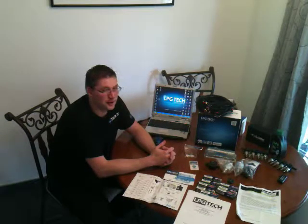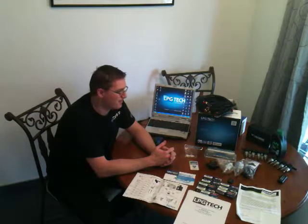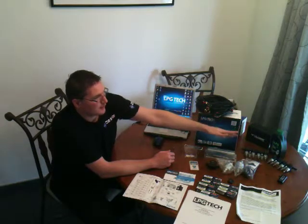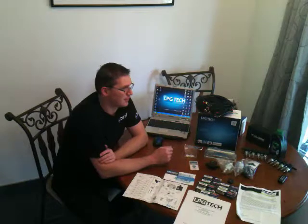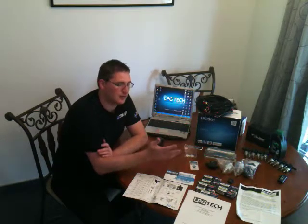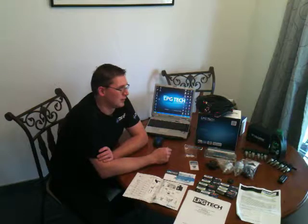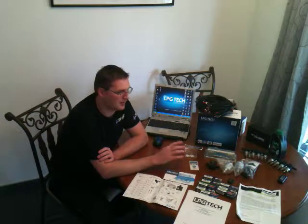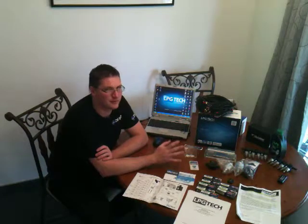AC Autogas is very difficult to calibrate. The only injectors I've seen work reliably with it are the HANA and the AC W01. If you use any other injector with AC Autogas, operating conditions will be completely different from one day to the next — it dies at intersections for no reason. It will never be an EPA-certified system in the United States. I dedicated a lot of work to AC Autogas trying to get it to work, and honestly, it just won't.